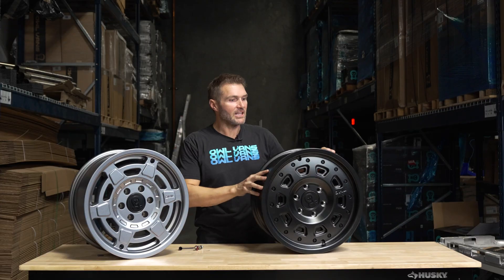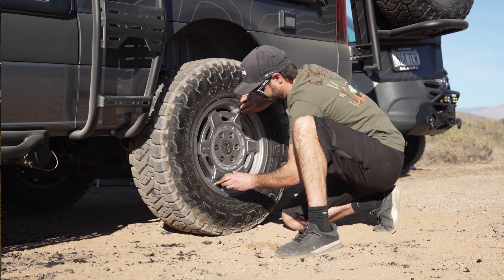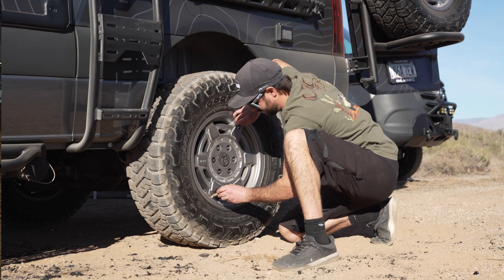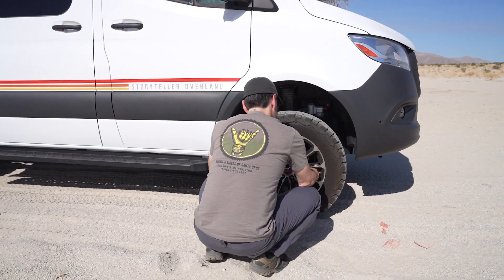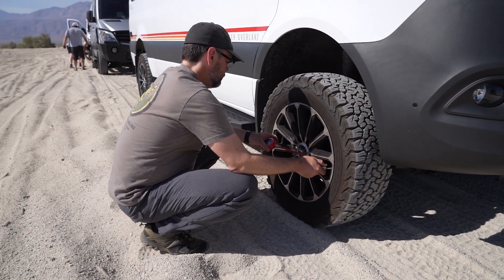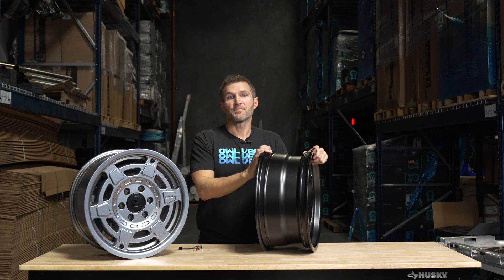This technology is not only in the Talent, it's in our Mojo as well — both available on our site. The last thing I want to talk about with these wheels is this bead retention ring. When you lower the pressure of a tire, it spreads the contact patch and allows you to get a massive amount more tire on the ground when you're off-roading, which is critical. In fact, the taller and skinnier your tire — counterintuitively — the more contact patch you have as you air down.